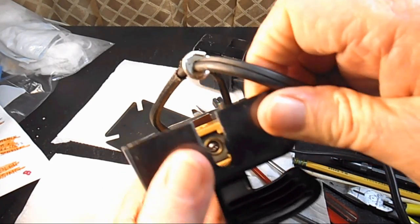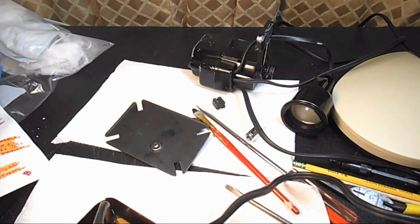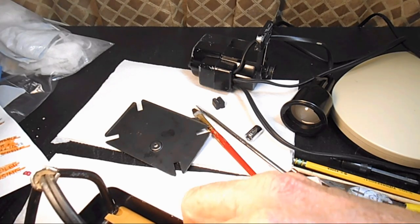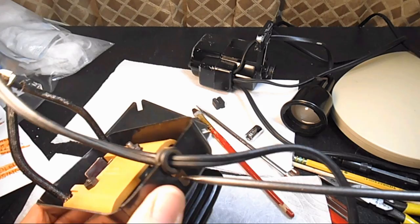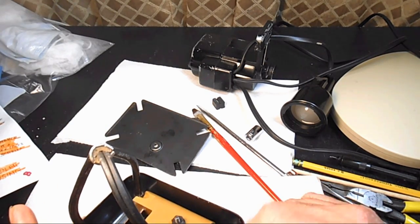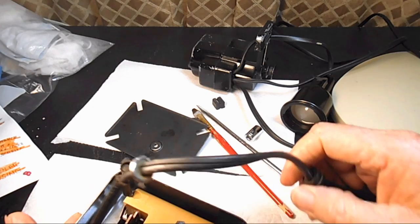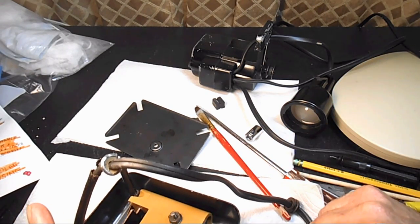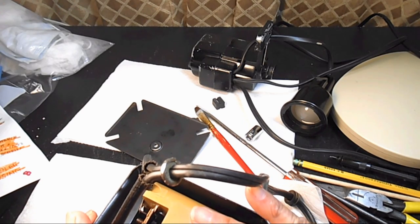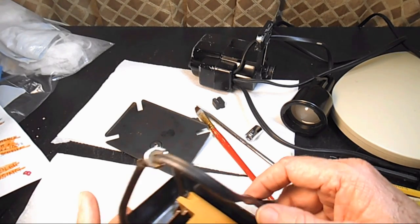It was more like fifteen minutes — I was answering some comments on the YouTube channel. But this is still at room temperature and has not warmed up at all. I think I'm going to leave it right there. It's got a lot more range than it did before. You can see the cutout here at the bottom — even when this grommet is set down in there, they left an opening so you can get the screwdriver in there to adjust it. Just remember to test that the unit doesn't feel warm after it's been plugged in ten or fifteen minutes and not in use — that would mean the electricity is leaking in and you have it adjusted too tight.